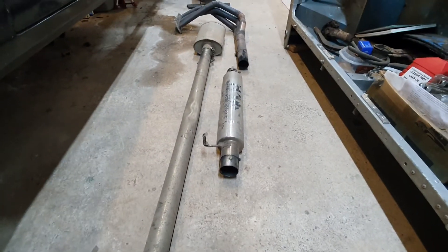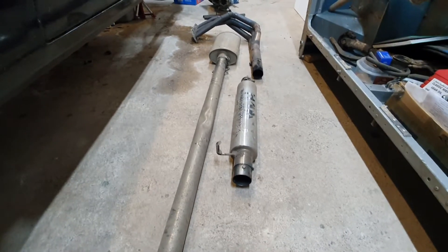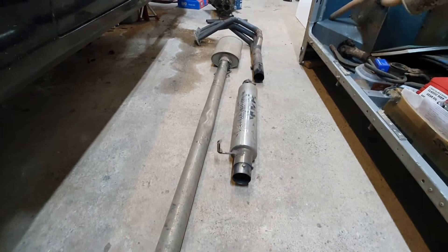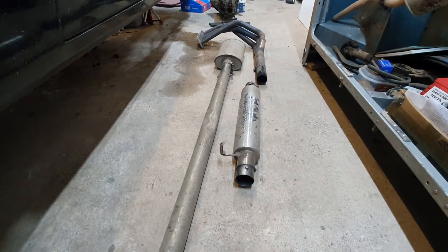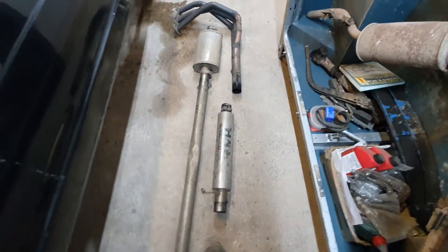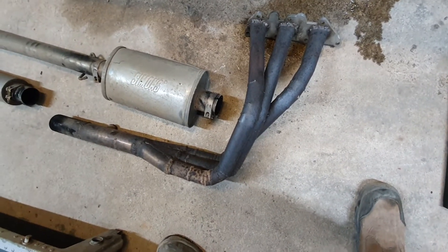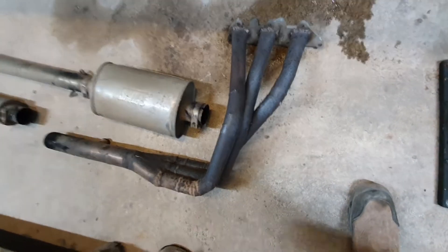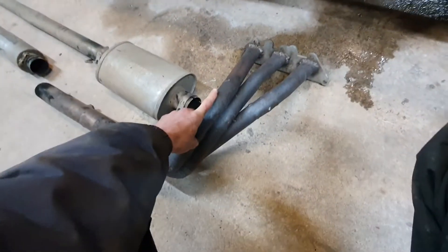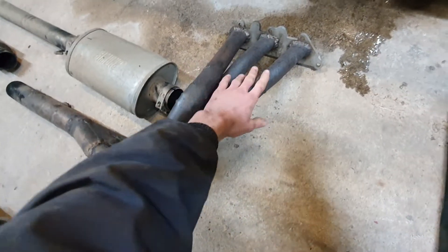It still makes bucket loads of power. As with any tuning, the closer you get to the cylinder, the more important and beneficial it is. This is right at the back, so it's increasing back pressure slightly, but all the power is made in the head in those improvements I showed you in the last video, and then these manifolds which are nothing like the log manifolds that were fitted on it. So yeah, 27-inch primaries. Now I say stainless steel — it's some cheap grade beginning with a 4. Obviously it's not liking the heat too much; it's suffering a little, but it's not too bad.